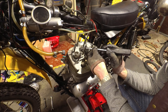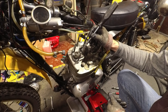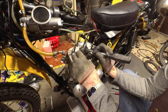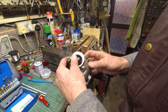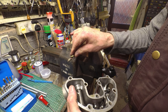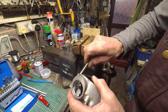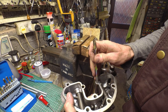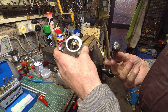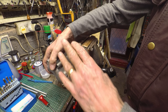And this again here — you can see it just comes off, rather too easily. Hasn't been stuck down with any well seal; I'm not sure I put any well seal on. I'll check back on the previous video — one of the reasons for making these videos. I've cleaned off the face of this pretty well, and this 9mm drill is just about the right size to clean out these holes as well. It's a pretty good fit, actually. That'll clear out the sealant that's in there and any other crud, gasket material or whatever. I'll do this for all the holes.